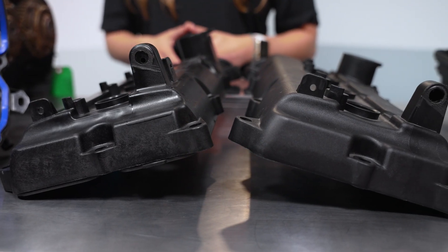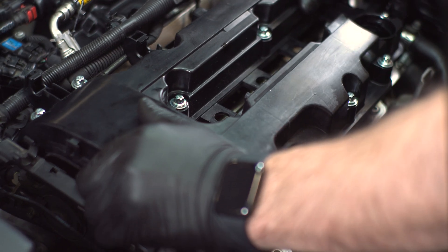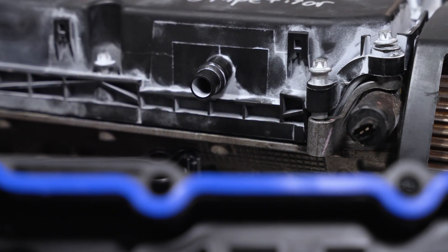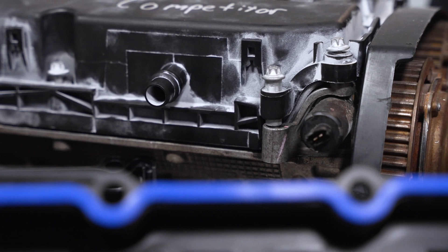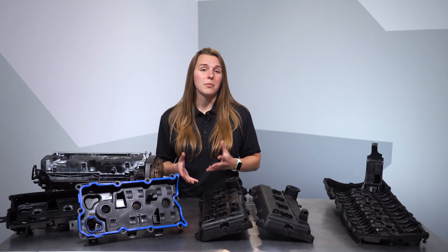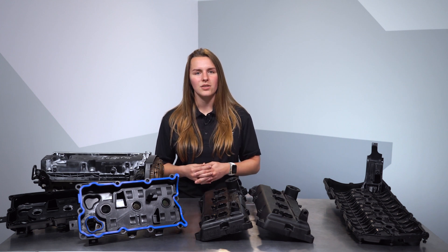Let me show you some Dorman pieces side by side with some other players in the game. Fitment is table stakes — if a valve cover can't be literally bolted in place, there's no chance it's going to work. But if you look at this valve cover one of our competitors offers for some General Motors applications, it can't. The bolt holes simply don't line up and this alignment dowel is way off the mark. It could possibly be made to work, but if the valve cover is forced into place the likelihood of a crack during or after installation is high. Alternatively the cover could be modified, but the removal of material will clearly weaken the part and take valuable install time in the bay. So why not just buy a part that's made correctly?